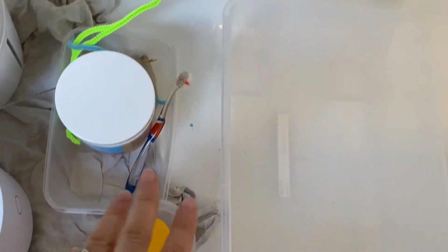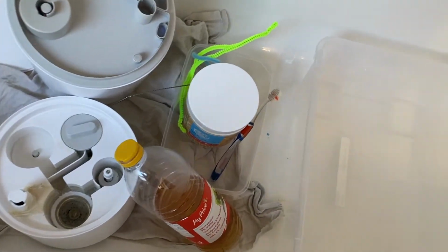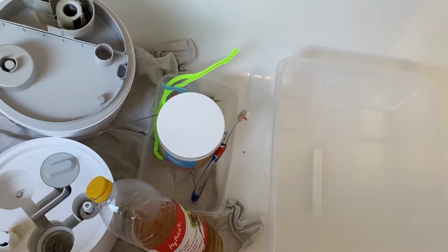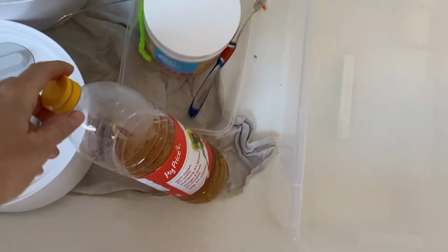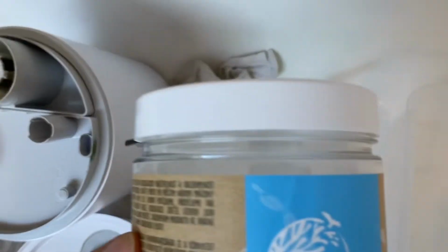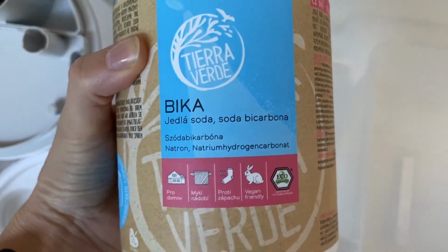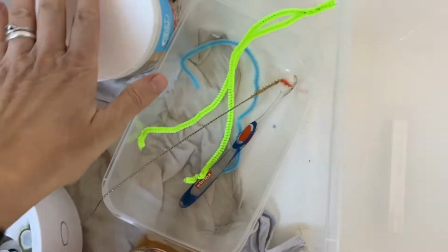So I'm just gonna use a few helpers, the kind of tools and ingredients that I use also for cleaning other house electronics, like the washing machine and so on. For me, the vinegar is always helping with lime scale, but also together with this bicarbonate soda. And I'm gonna use these two as main ingredients. I'm gonna let it sit, the vinegar with sodium bicarbonate, and then I'm gonna use some pipe cleaners